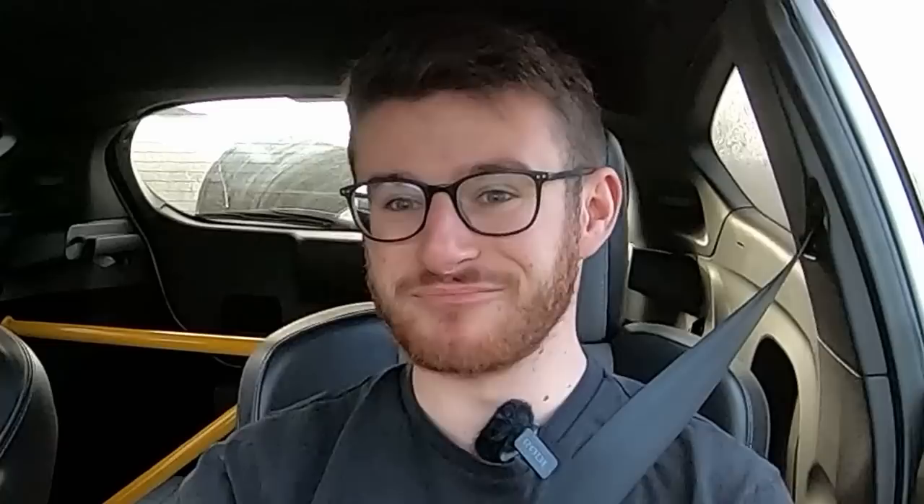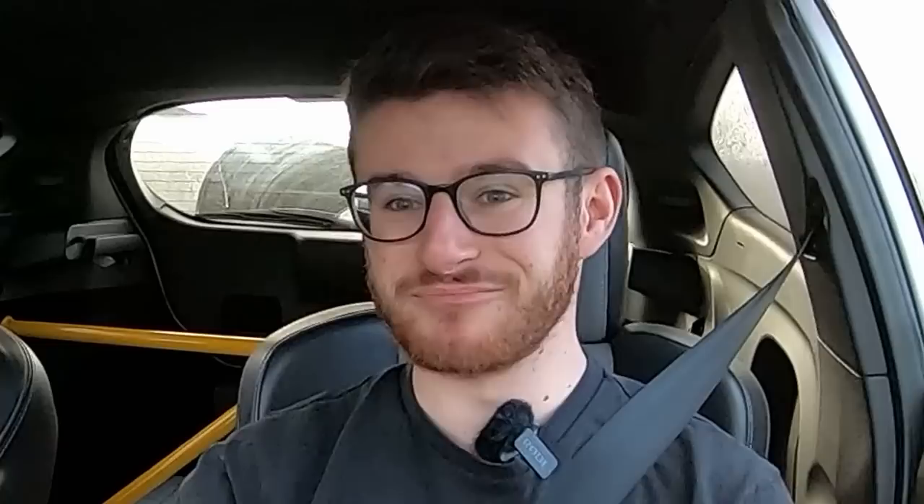It's still good in the corners — it does grip well. Brakes are good as well — we didn't talk about the brakes. They're standard discs, Mintex 1144 pads. I had Pro Race, but the squeak was unbearable. The brakes are good actually, they are really solid and they don't really fade. As I said, they will eventually fade. But I've got RBF 660 fluid, so it's quite good fluid.